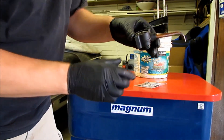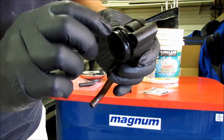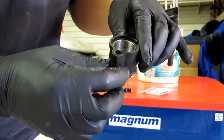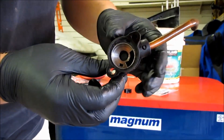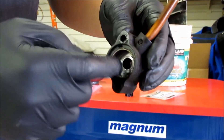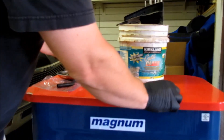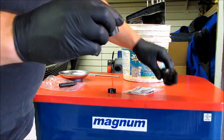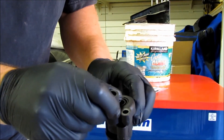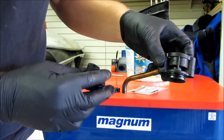Just looking at my other pieces here — the body. It's not new but it's fine. The o-ring's still there, it's pliable and soft, so I'll clean that up and put it back in. There aren't any huge wear marks inside here. The part that's a wear item would grind up if sand got in there. There's the top of this piece — it goes together like that with this plate in there, and then the water shoots out here through the tube up top and is drawn in through the bottom of the leg.